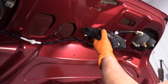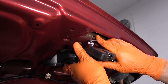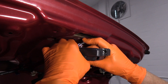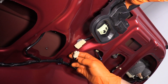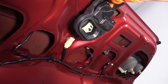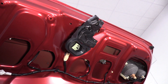Going to reverse the procedure to install. I'm going to put the latch rod on first — just poke that right through. Move the plastic piece over and latch it. I'm going to latch that in first, let it click in, then connect the electrical connector. Now I can get the two mounting bolts with the 10-millimeter socket.